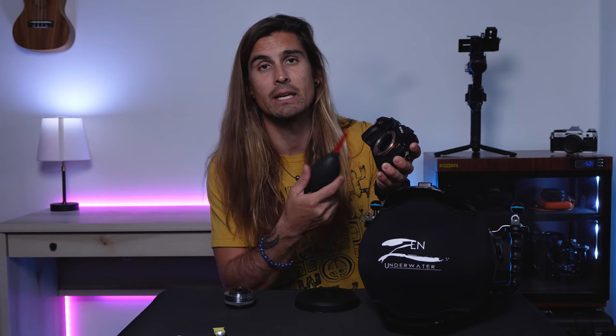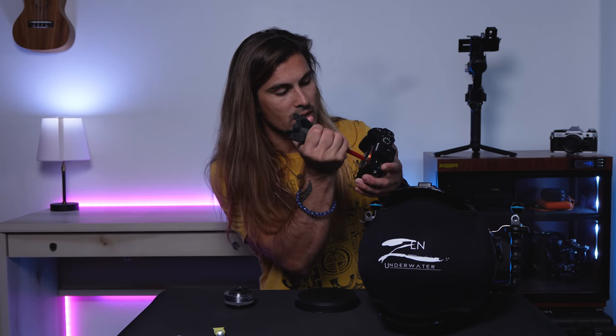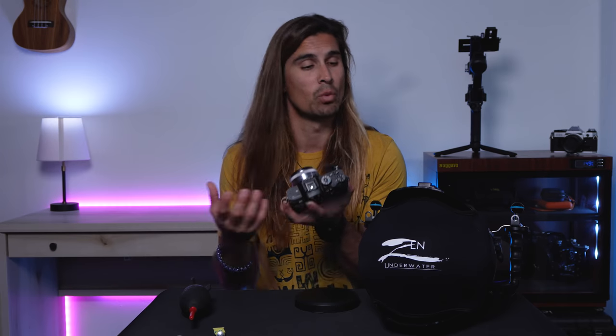Caring for your camera body should be very simple because if you've maintained your housing very nicely, there should never be water that touches this camera. However, there are times while changing lenses that we might find dust or the tiniest of hair get inside. I like to use my air duster to clean out my sensor, give it a look and make sure that there's nothing on it, and then reattach the lens. You can always send in your camera body to get professionally cleaned — the cleaners will clean off the sensor to ensure there are no marks or smudges inside. But again, it's very easy to avoid if we just focus on never leaving it open and exposed while we're piecing things together.